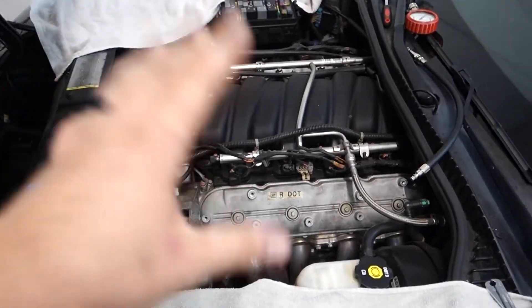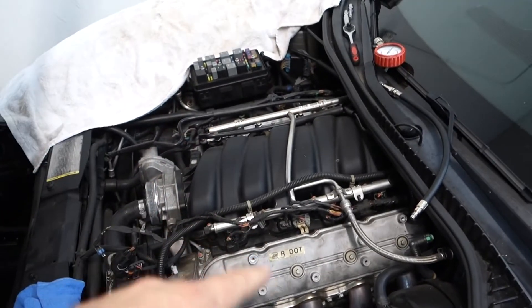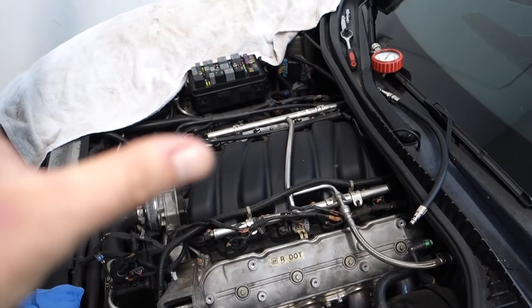Now that that checks out, we can start removing everything off the top of the engine — intake manifold, some accessory components — then we can pull valve covers, get rid of the rockers and push rods, and get ready to pull these heads off. This process will apply and work for all C6 Corvettes; the compression numbers are going to be different depending on your motor, so make sure to look those up. This is just a basic test to make sure your cylinders are compressing about the same. It's nothing definitive and won't pinpoint exactly what's wrong, but it does give you some indication of your base engine health and compression.